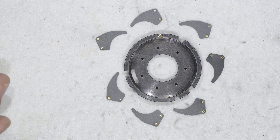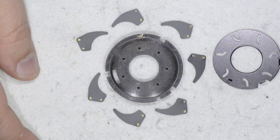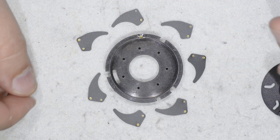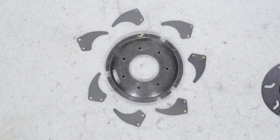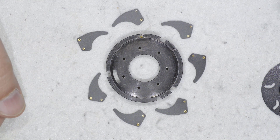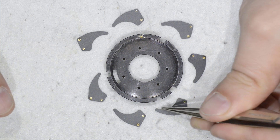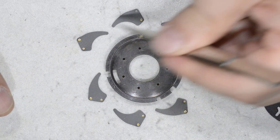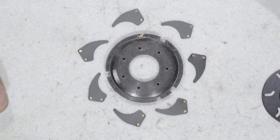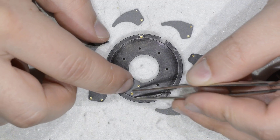Hello friends, I'm back. I'm done with the cleaning — it was extremely simple. I took everything out of the lighter fluid and dried it with some toilet paper. I'm ready for reassembling the diaphragm. What I like to do — and this gives me an indication of how I should reassemble — is take the round parts from the diaphragm, arrange them in a circle, and this gives me a good indication of how to put the things back.